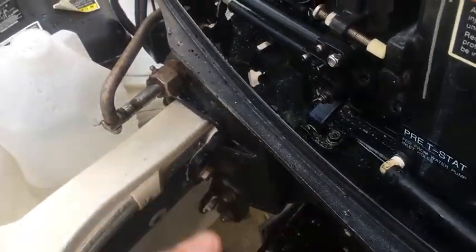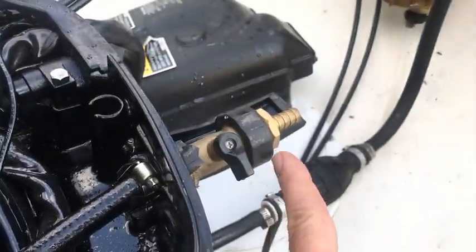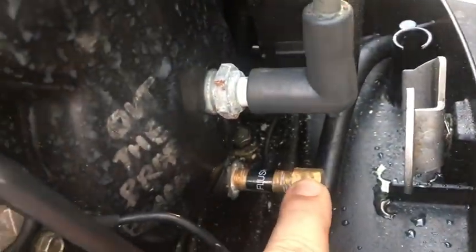This required quite a bit of cleaning out of this hose — take it apart here, take this hose off, unscrew this, and blast it with this nozzle fitting and a piece of rubber silicone tubing. This here goes into here, open this up and backfill it, then go into this and backfill it. Take this off, put your palm over it so it forces the water to go out the exhaust.